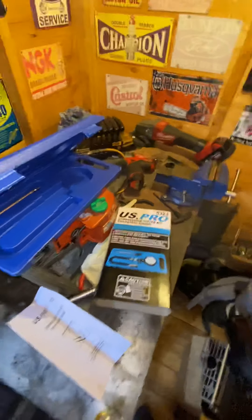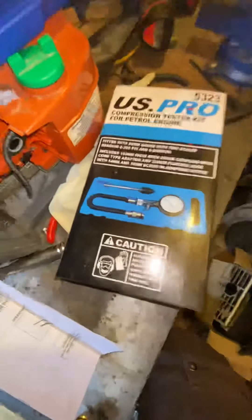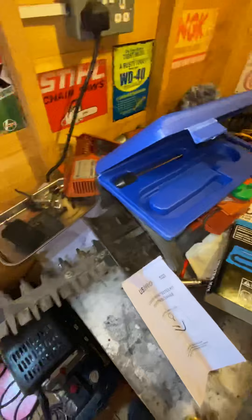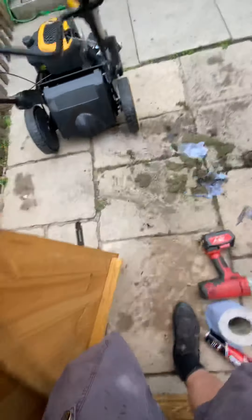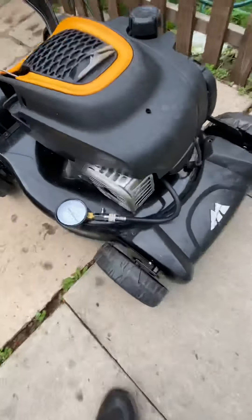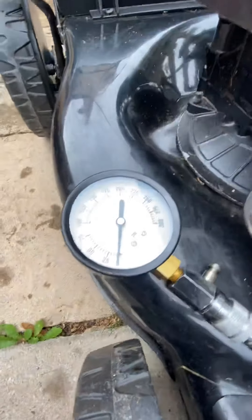On a self-propelled or pedestrian motor unit small engine, I've got it all rigged up ready. It comes with a 14mm and 18mm screw adapter. On this particular unit I've got the 14mm screw adapter in already, got the plug out — small plug out. Let's go and have a look. We just crack the plug out, make the 14mm adapter in, there's your PSI gauge.